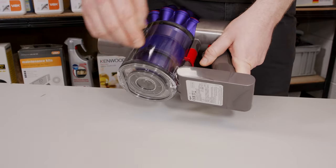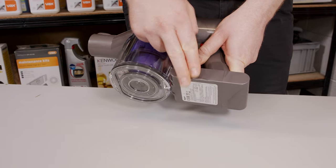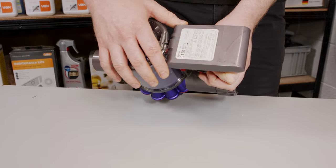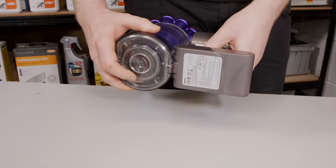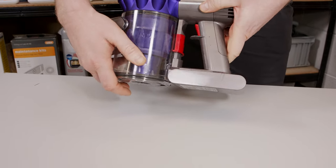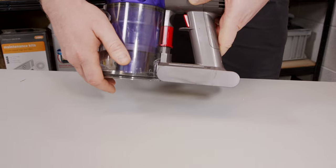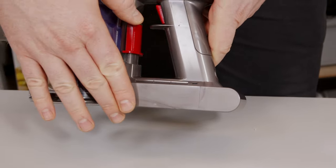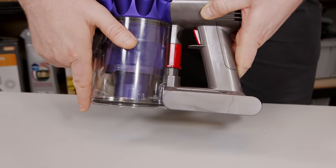Another reason is because the battery is damaged, so check for any visual signs of cracks that would stop it from working. If there's no visible damage, the battery will still indicate it is faulty by flashing a red warning light 12 times or more. This one is okay, but I'm going to show you how to change the battery anyway.